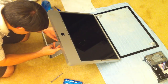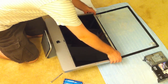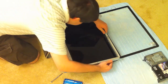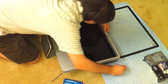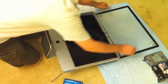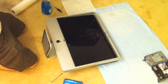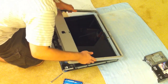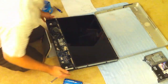After you do that and that little area is clean down there, you can pry loose the top of the casing. You need to be careful not to break the iSight cable at the top middle. You can pop it up just a little bit and then you can see the cable there. Make sure you don't rip that cable otherwise you won't have any iSight and your computer will be somewhat blind. It might actually be some sort of sensor too — I'm not sure exactly what's up there. I just flip over the lid because it's a little easier that way.